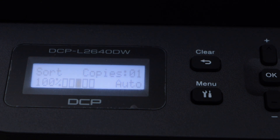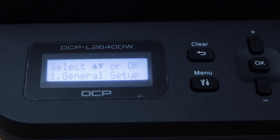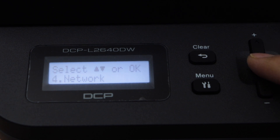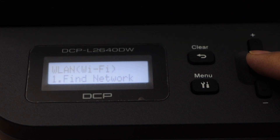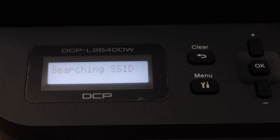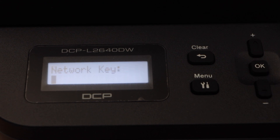Go to the printer display panel. On the main screen, the next step is to do the Wi-Fi setup. Click on the menu button and scroll down to find the wireless settings. Select Network and press OK. You can use wired LAN or WLAN Wi-Fi — press OK. Select the first option, Find Network, and press this button to switch it on. It will search for SSIDs — your wireless routers.